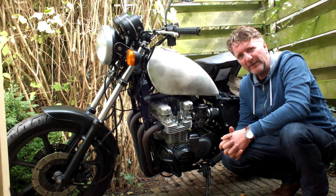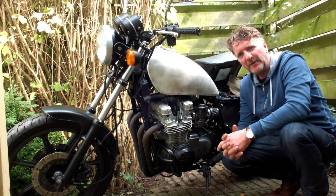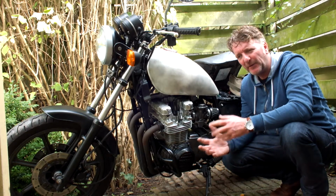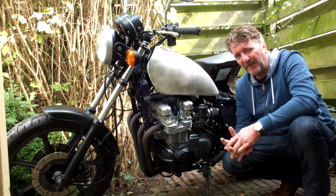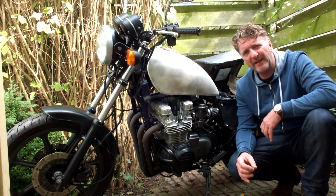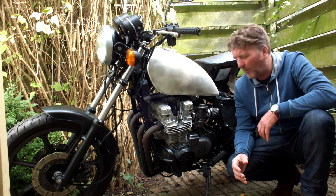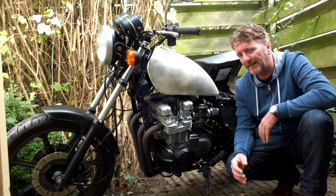I did see a better result. There was a little bit of a difference, but actually not enough. So I went to a 132.5, which gave a little bit of better experience at the higher RPM range, but still not sufficient. So I'm thinking I have to really start moving up. So I'm going to go to a 137.5 or a 140, sorry, at the high end. So that's a secondary main jet.